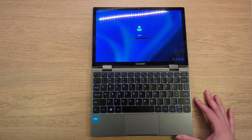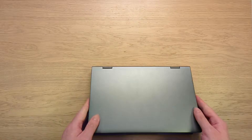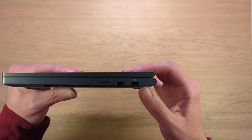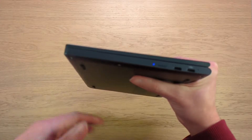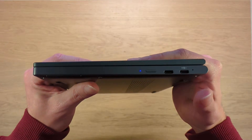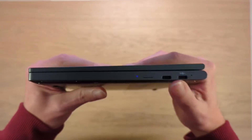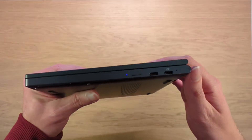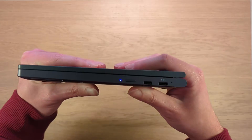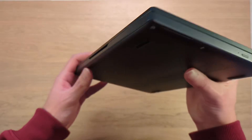Before we open the device, let's go over the USB-C ports. One is marked as a charging port, but the charger included with the device worked on either port. I also tried a charger from my Steam Deck — that worked — and a 100W USB-C charger also worked. Very low-power chargers included with phones couldn't charge it, so just be aware that it charges over normal USB-C chargers but not all of them.